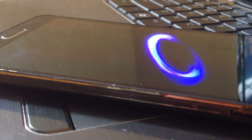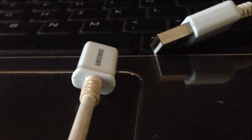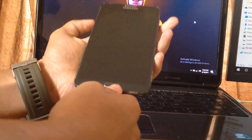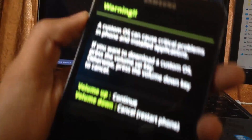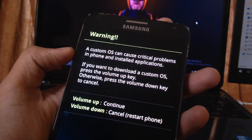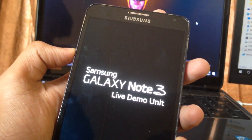So let's start by booting up the device. For this trick to work, you'll need to have access to a PC and a USB cable to connect your phone to the PC. The first thing you should do is connect your Samsung device to the PC using the USB cable, and then press the home button and the volume down button at the same time. You'll be directed to a warning screen to confirm whether you want to enter download mode. Now, get out of download mode by pressing the volume down button and you'll be booted up without any issues.